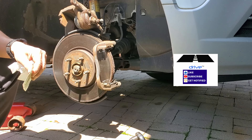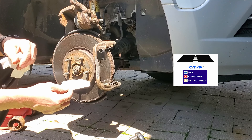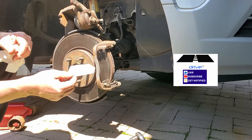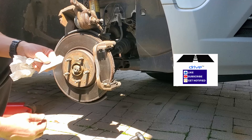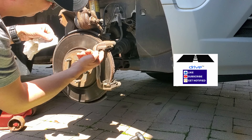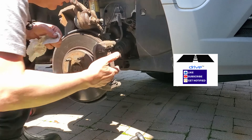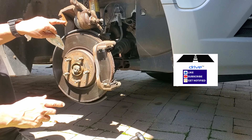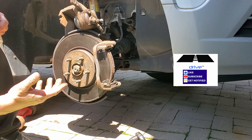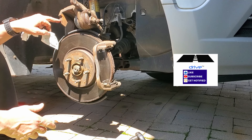When you buy a good quality premium pair of pads, what usually comes along with it are the clips as well as lubricant. Don't cheap out and get economy ones because you won't get the new clips or the lubricant, which are both very important for properly installing the pads. I've already pre-dabbed and lubricated the bottom one — now I'm doing the top. You'll also put lubricant on the inner side of the caliper so the pad can freely move, because sometimes that squealing is caused by the back of the pad scraping against the inner part of the caliper.